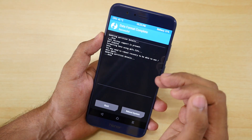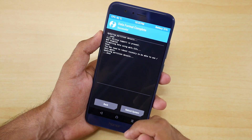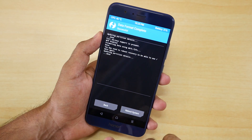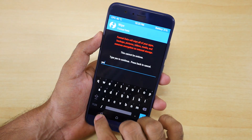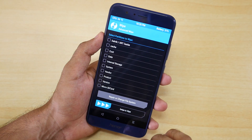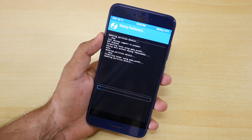If you want to know how to backup data on your Honor device, watch my 'How to unlock bootloader' and 'How to flash TWRP recovery' videos, linked in the info button. Now go back to the main menu, go into Wipe, then Advanced Wipe, select Vendor, and select 'Swipe to Wipe.'